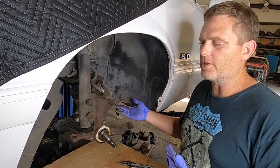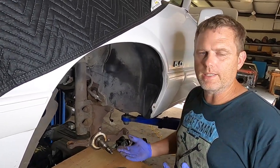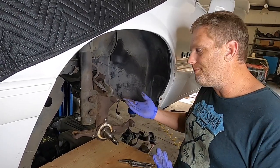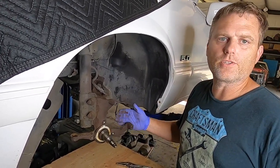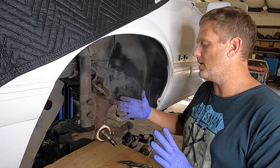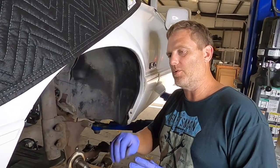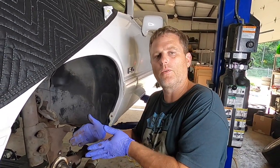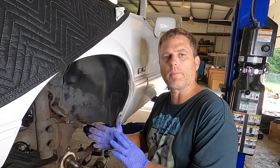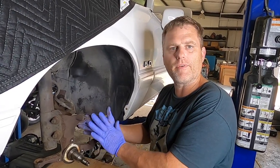they are made of a certain type of rubber that is good for brake fluid. But over time, the brake fluid becomes contaminated. It can affect the rubber, and just being submerged in the brake fluid for 30 years is gonna affect it, so it could start to gum up and drag on the piston. It's very important that the piston releases, because if it's dragging and you hit the brakes, when you let off, it will not release. That means you still have a little bit of pressure on the brake pads. That symptom can cause one brake pad to wear faster than the other.